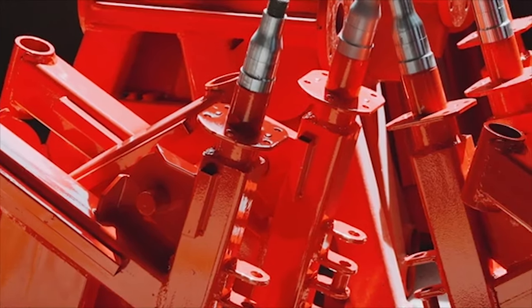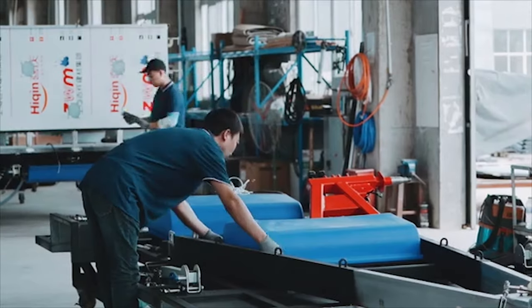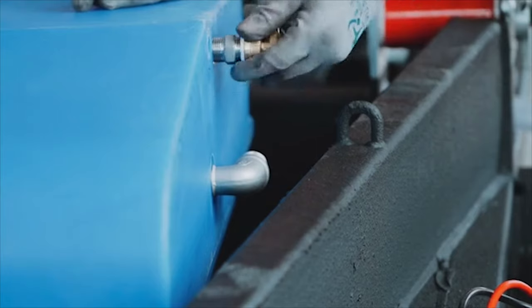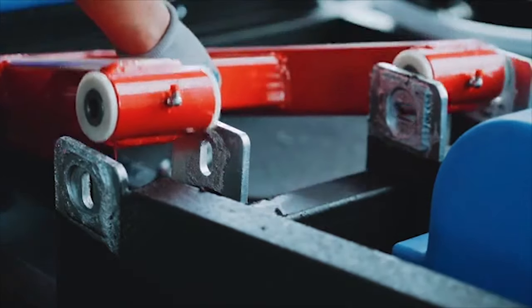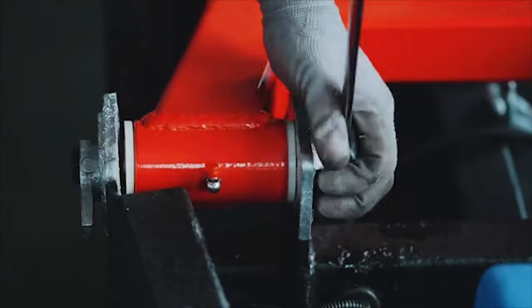The trailing arm suspension is likewise manufactured in-house. The initial assembly of the suspension and the installation of the polyethylene water tanks is done with the chassis inverted. This increases efficiency. The camber, toe-in, and torque adjustments are all done in Australia as part of the final assembly that we do here.